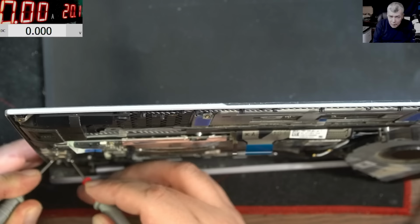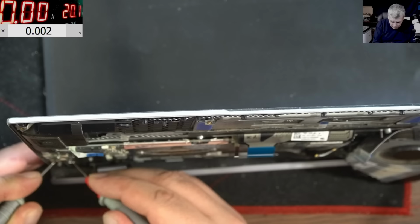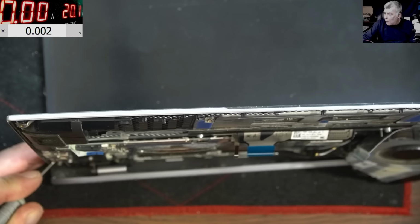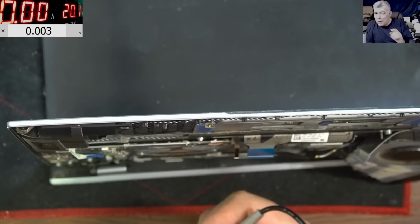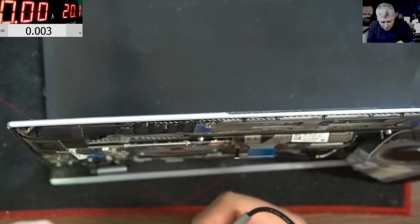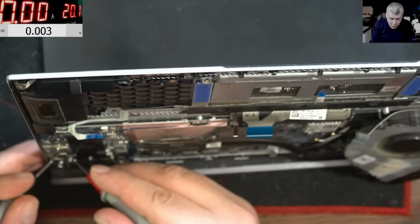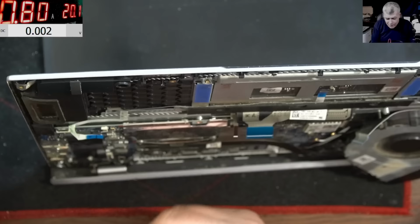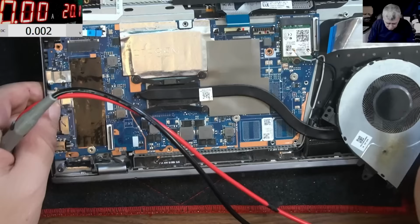Okay, let's remove this cable. You can't see the power supply. No, you can't see it. So the power supply, you can't even hear it. It's very short. I can see the red LED from the current flickering. So from the moment the laptop didn't come on, we had plugged in the screen. So removing the screen, the laptop is starting, 1 amp, you can see. So the short is on the screen. We have a short circuit on the screen. Okay, that's bad.